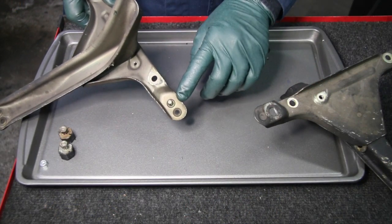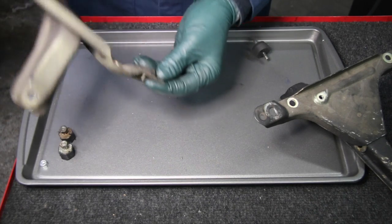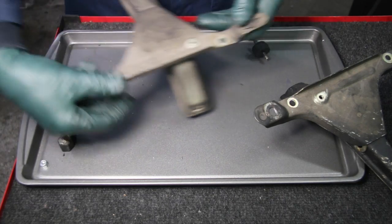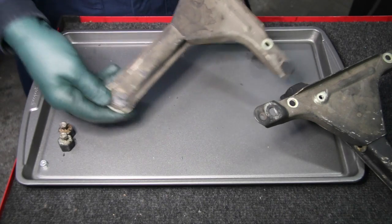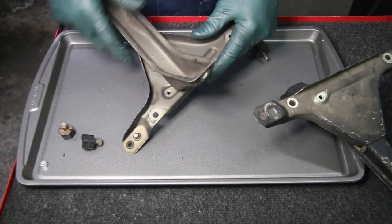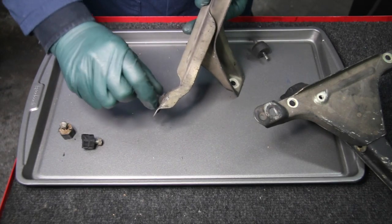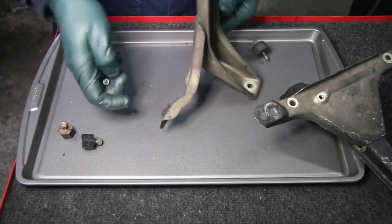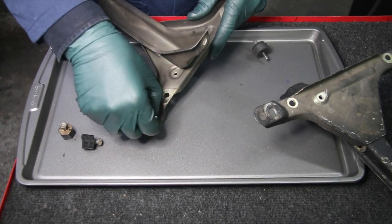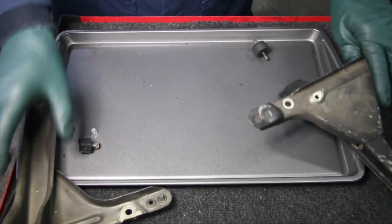On the underside of this bracket, you can see how that shock mount screws right into the hole and tightens down tight against the bracket here. Well, that one's broken, this one's broken, this one's broken. The problem is if this starts to loosen up, it'll even make it worse. So the solution here is to put a locking nut. Once you tighten the shock mount down tight onto the bracket, then you go on the back side and get a locking nut and tighten that down. You follow me? So when you do that, then this won't happen.